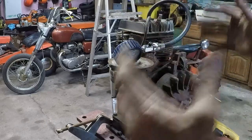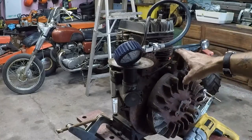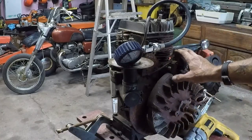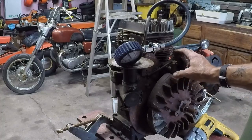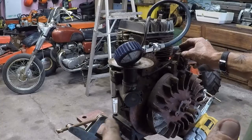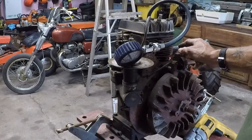I did a leak down. Leak down falls within the spec. All I've got to do is get spark back into it. We'll get a bench run on it. And as soon as I get all that done, I will shoot a video of it running. But I wanted to tack this on to the Clinton engine video just to give a prelude to what's to come. So we'll see you guys later.